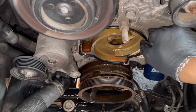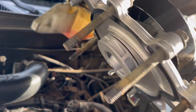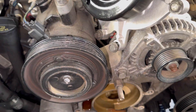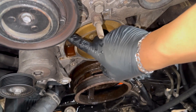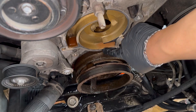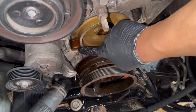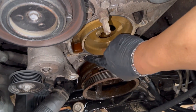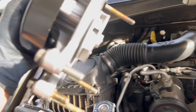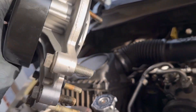Take off the old gasket. The new pump came with a gasket already installed. I'm not going to use any gasket sealer — you don't need it on this one. Just make sure the mating surface is completely clean, especially at the bottom. Use a sponge or a metal wire brush to make sure it's fully cleaned out before you put the new water pump in.